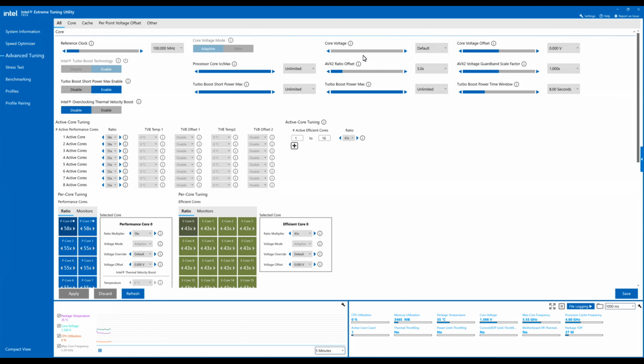That might be one of the most exciting things about this. But we did try the auto overclocking. I think it only adds 100 megahertz. We do like the addition here of actually being able to visualize what the cores do. XTU is a good program if you want to see what your cores are set at. Here, this is boosting up on this motherboard at 55x on each core. I tried some motherboards and XTU told me they were all set to 58x by default, and I was like, no. What is it called on your motherboard? Then I went and checked it and disabled it because you can't turbo all your cores up to 58x on this CPU and not throttle. So XTU is good at indicating that. You can make real-time voltage changes, real-time everything changes basically in XTU. Everything you really do in the BIOS you can do here.